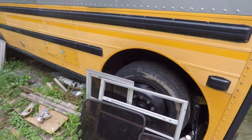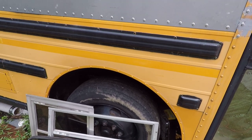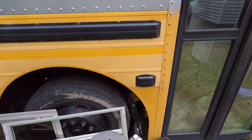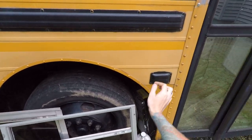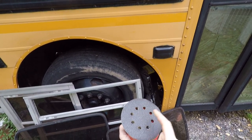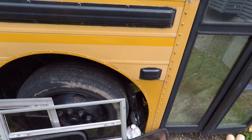Time has come to sand the bus before painting. I'm breaking this job up into several different steps. First thing I'm doing is the big parts — anything I can get with the random orbit sander, the big surfaces, I'm doing that first. Then I'll get into the details around the rivets and all that. I'm using a random orbit sander with 120 grit sandpaper. Of course, I'm going to wear a mask and goggles for this — you've got to protect yourself, you don't want to inhale this.